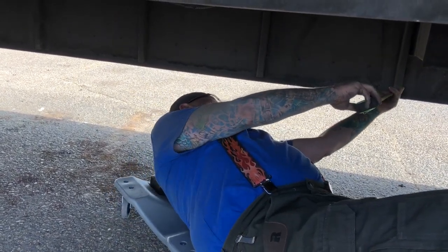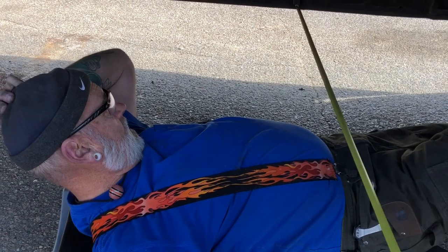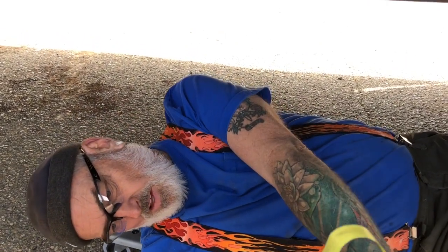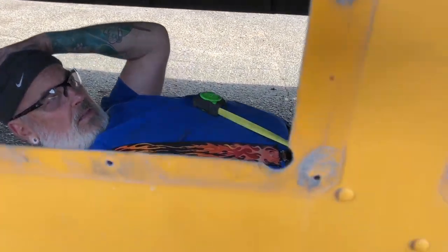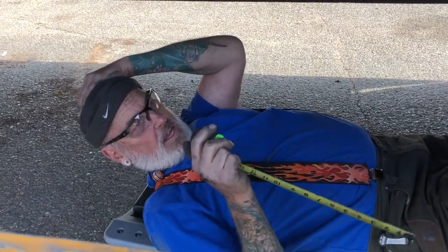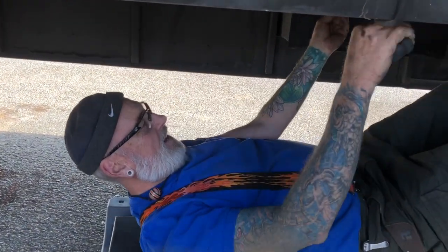So what Chris and Joe have been saying is make this understorage. Those storage bays, you want clearance when you go over a bump. So this is the higher, the center. But still, by making them flush to here, how high was this to the ground? Is that like 12 inches? It's 14.5. That's lots of clearance. So you'd have four more in the middle than you do on the ends. And that water tank will fit in here easily.